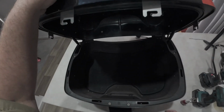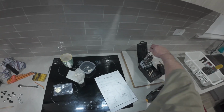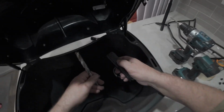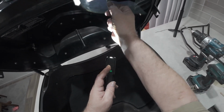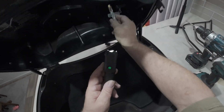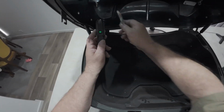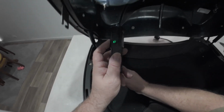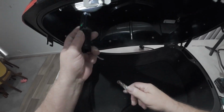So we're looking here, they're looking right. What you can do is get a bigger drill like this and deburr it. I'll show you what I mean. I don't know if you can see up there, see how it's got a little burr on it, and just run this like this. See, now it's nice and clean and it won't have any crap. It'll sit even when it goes flush. We can do that. See how there's no gap there? Very, very good, and it gives it extra strength.